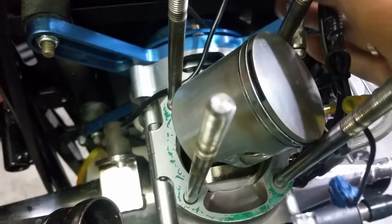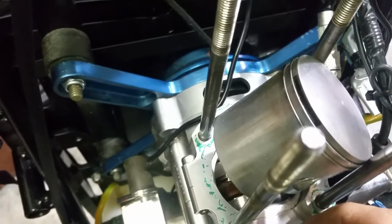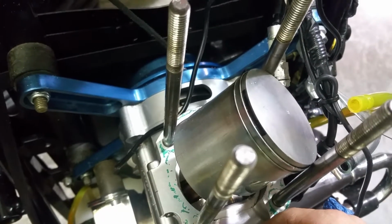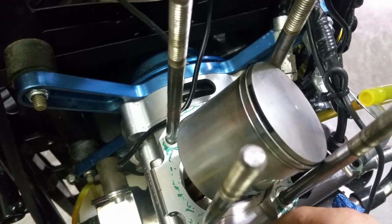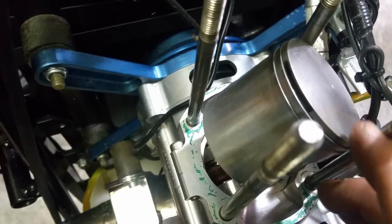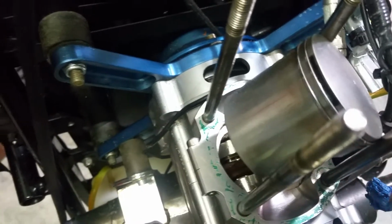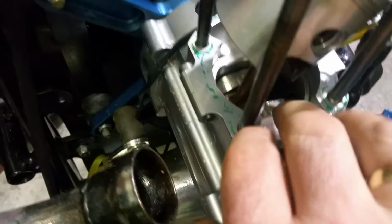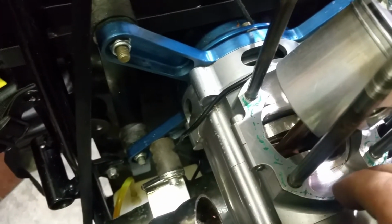At the time, you can inspect the cylinder top, and if you see some sort of scratches or damage or burning, then you know you need to order more parts. So that's the reason I assume that I have only a blown gasket and the cylinder must be okay. Now I was a bit concerned that I may have to place another order for different parts right here inside, like rods and, I don't know, some crankshaft stuff.